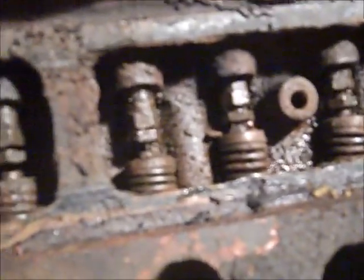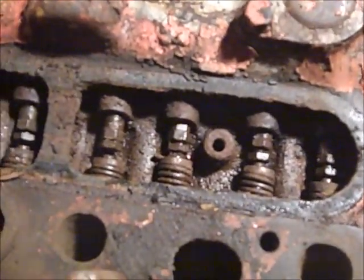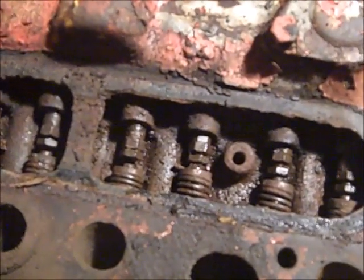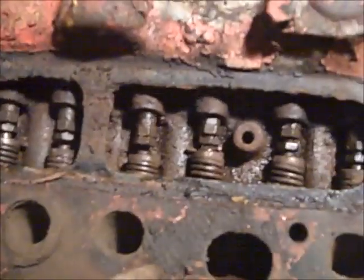Before I do that I'll have to take the valves out — that'll be a job. Gotta take the front cover off and get the camshaft unstuck, get it cleaned up, then we start putting it back together. I called today and that new piston's gonna cost me forty dollars. Then of course a head gasket set on top of that. I'm glad I'm doing a thousand dollars in this thing when I get it done. Oh well, that's the way it goes.